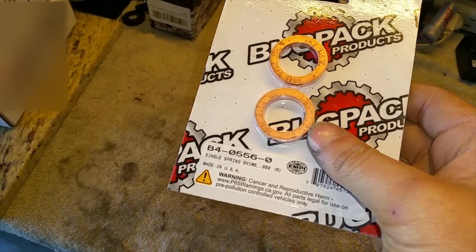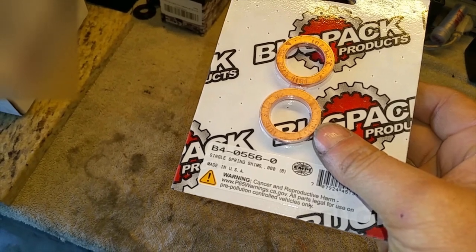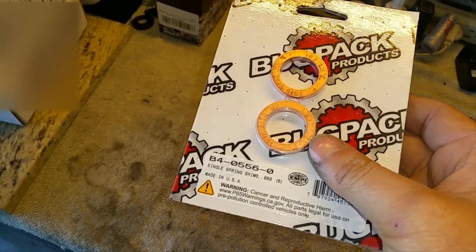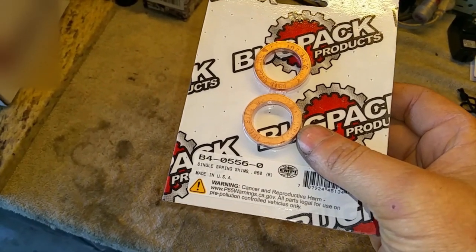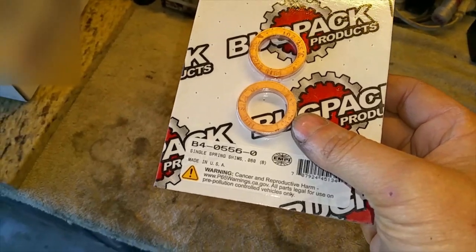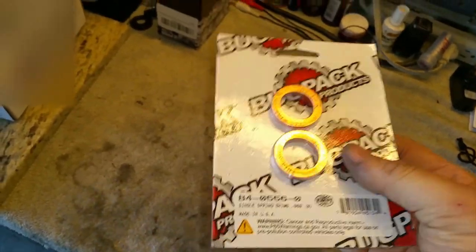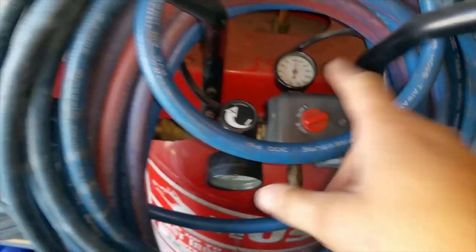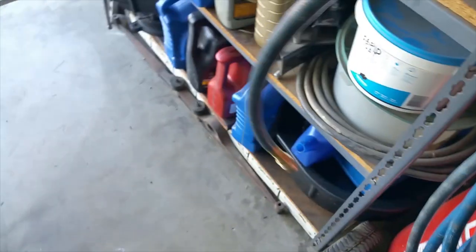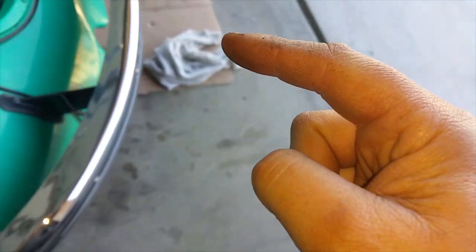I don't have the valve compressor or the spring compressor, so we're going to jerry-rig something up. I don't know what I'm going to come up with, but I need to jerry-rig something, or I'm going to have to buy the tool, which would be kind of nice to have, really. I mean, seriously. So I've got my compressor already all juiced up. Because we're going to hook up the hose, this hose, to my compression tester hose, so we can hook up to the number 4 cylinder,